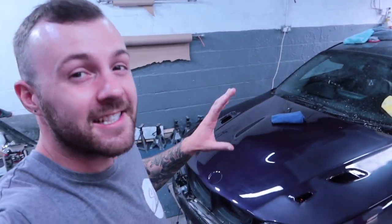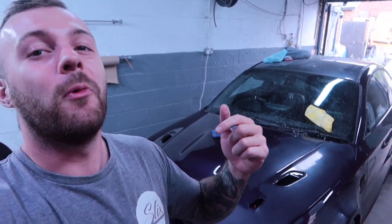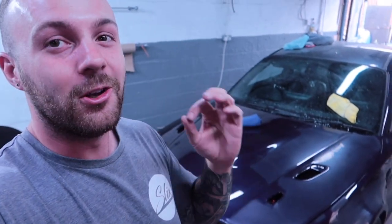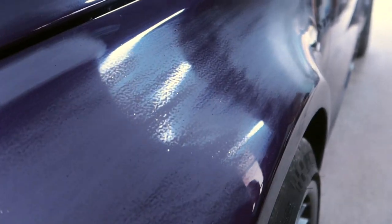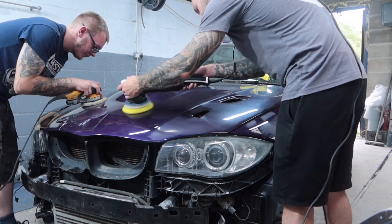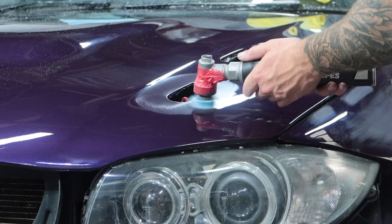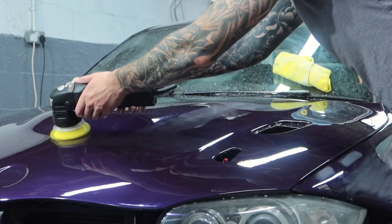It's another day and we're back. The final stage of the painting process is probably the longest — flattening and polishing — and it can be tedious. Luckily, this is an area where I have a certain level of expertise, given that I own a detailing business. The reason we wet sand cars is that it's pretty much inevitable you'll get dirt nibs in the paint, and wet sanding also smooths out the orange peel to make it almost like glass. As Luke attacks the sanding, I attack the polishing, working together as a team.